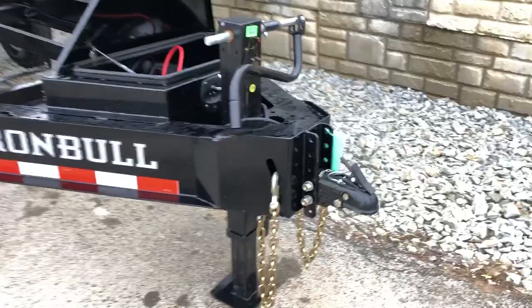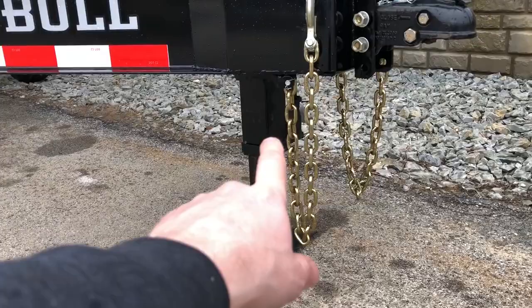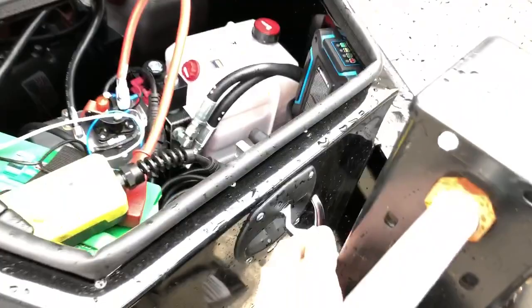Up front it's got a nice heavy-duty coupler. Notice it's also got the integrated chain holder. It's got an adjustable cast coupler and the 12k jack. If you're not familiar with the 12k jack, that's the biggest style jack readily available in this size trailer. It's got a spring-loaded inner leg that will pull down, so you've got two different ways to adjust — you can pull the arm, swing down the inner leg, or extend the outer leg. Gives you plenty of adjustment; no need to carry around wood blocks. A little detail we like: they use a T-style handle, not a paddle lock — a lot nicer style handle.